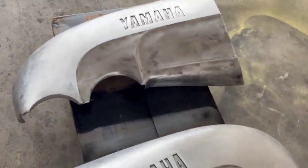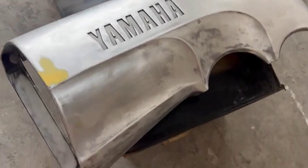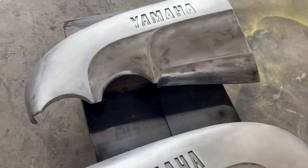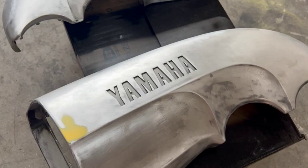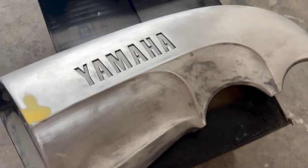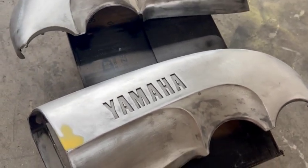Okay, so we're all cleaned down. We've repaired all our dents and our big scratches, and we're ready to put some primer on. I've also wiped them all down with thinners, so hopefully we won't get any flare up or silicone anywhere. So let's get 3 coats of primer on